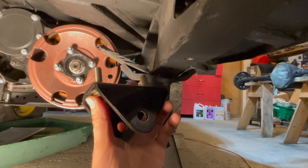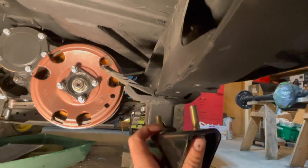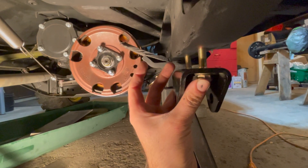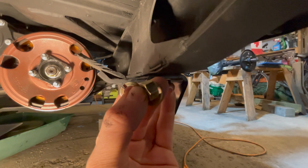The pivot eye bolt bracket is installed towards the front of your Jeep as we're working on the rear, and we'll have the bolt set up like this. You want to stick it through the two holes shown here, install your bracket pushing the bolts through the frame, and on the back side we'll put a washer, lock washer, and nut up in the frame.